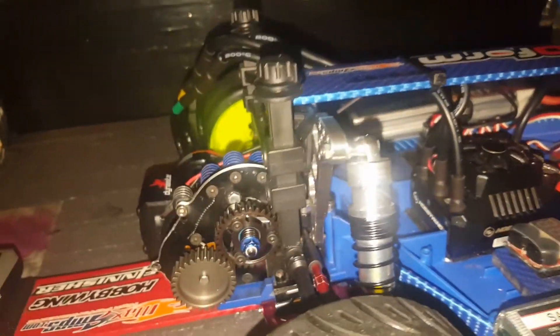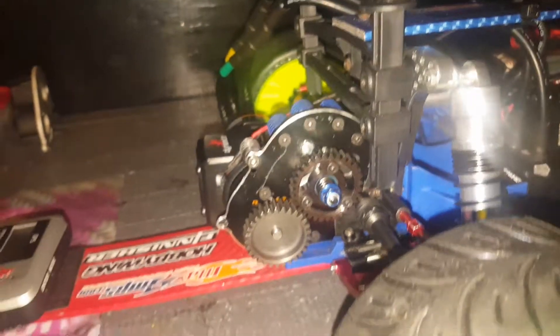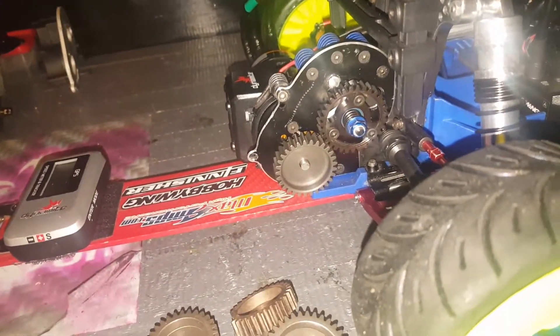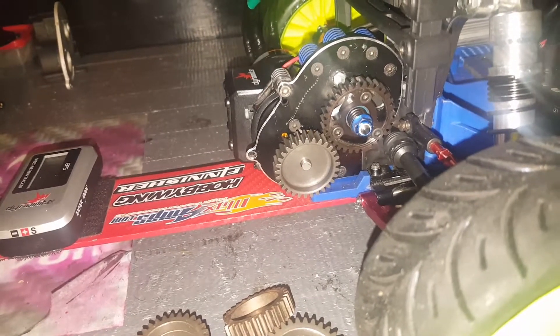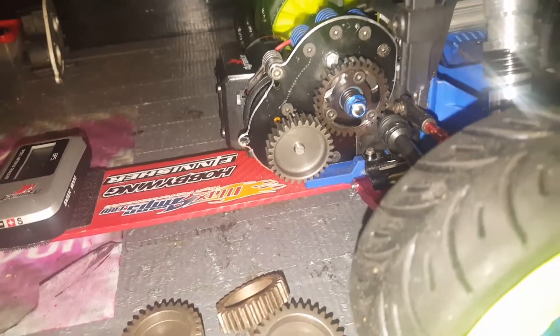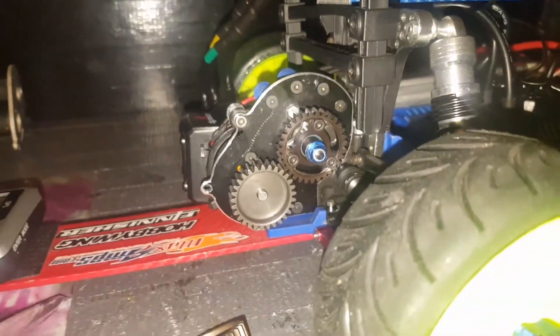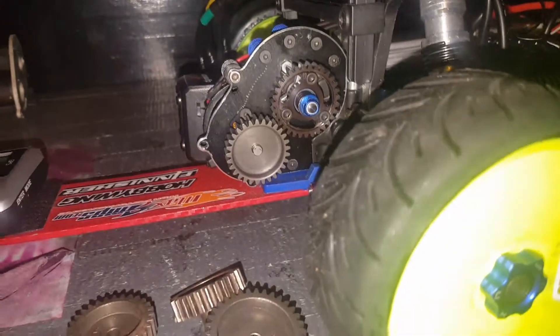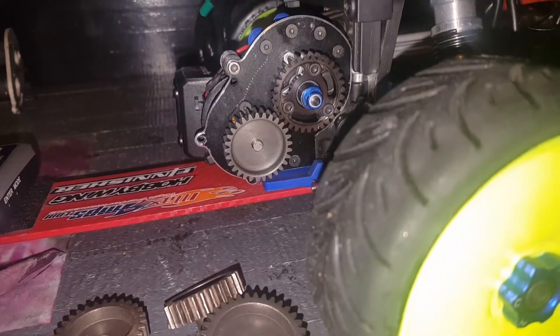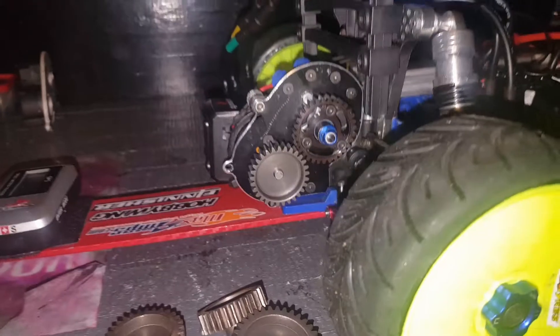I mesh them all the same way, so I have plenty of room and it's not tight or anything like that. Everything seems to be fine, but what I'm thinking is drag racing with one gear is not gonna work because it's not the cars — it's the takeoff that's killing it. It's the takeoff that's just snatching all the teeth off and destroying the gear. On 6s and 8s I can't just take off like that with these gears. I usually have to roll into it and then let it go ahead and go for a while, and then I'll see the numbers that I want.